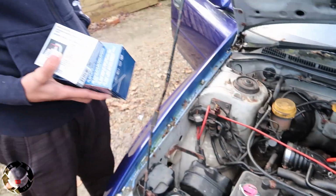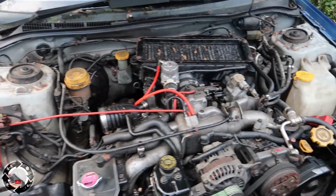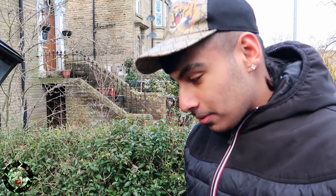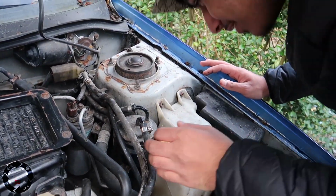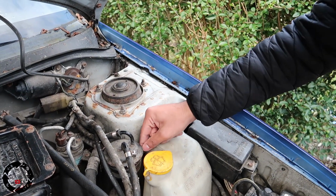You got the spark plugs? Yeah. Right, so before I put the spark plugs in, let's do the easy one first. So let's do the fuel filter. To do the fuel filter, we need a Phillips. Let's see if you can work out how to take the fuel filter out. There's a bracket hole in it. Oh, it's a big clip. Yeah, it is a big clip, you're right.